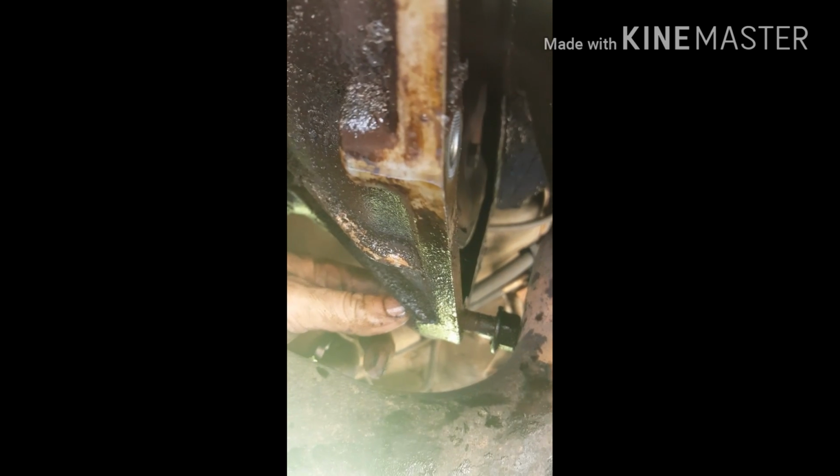I took the flex plate off, which is 18 millimeter on each side, and then it's a 1/2 inch on the others on the flex plate. And you're gonna have, obviously, either 2/18s, or if you're good and strong, you can hold it with a pair of channel locks and just take those two loose. These two up in here on the back side, those are actually 1/2 inch. Welcome to the Jeep, working in grease.